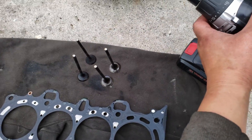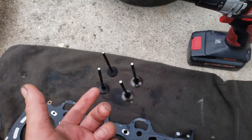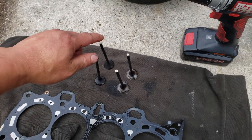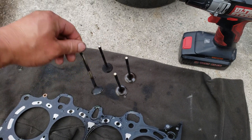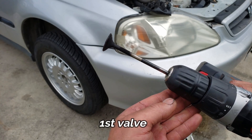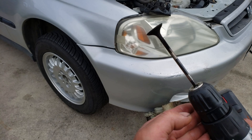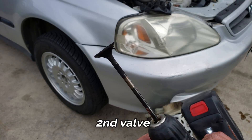I just put the valves onto this and spun it to see if they're bent or not. These two on the intake side are good, but both of the exhaust ones are bad. Let me stick this one off first and show you how it looks — pretty bad. This one's a little off as well, not as bad as the other one but it's still off.